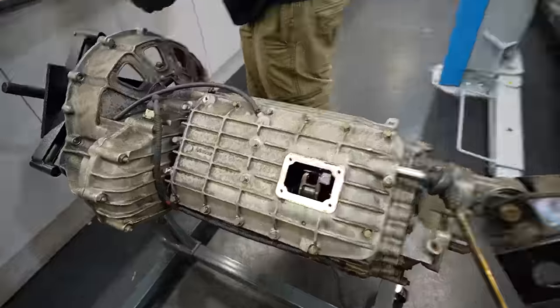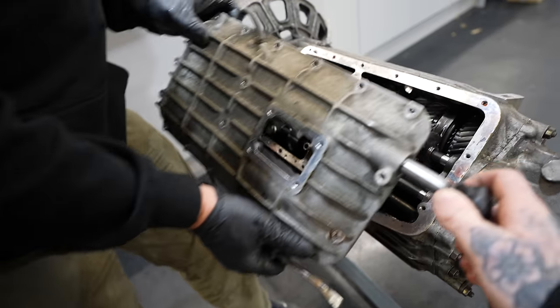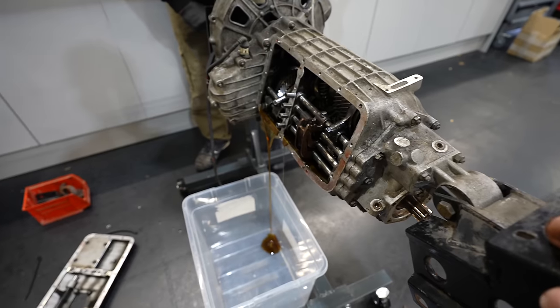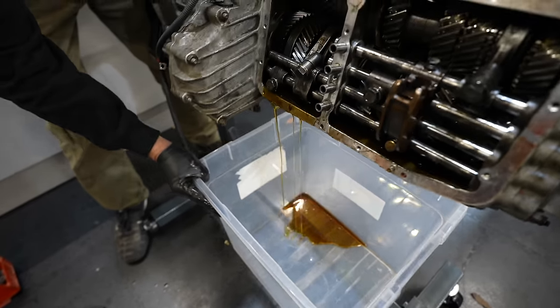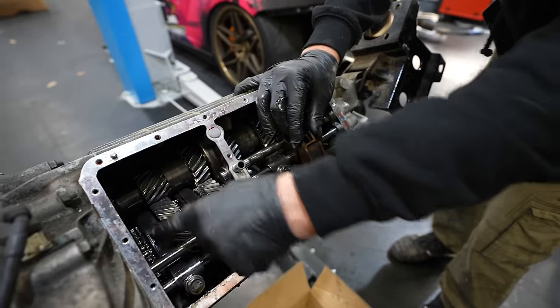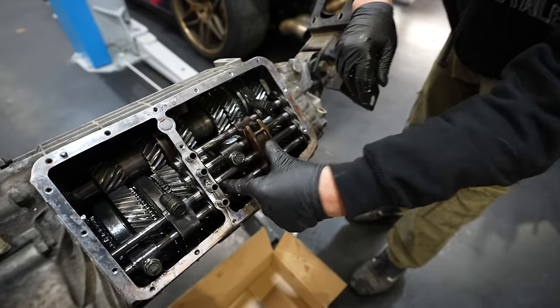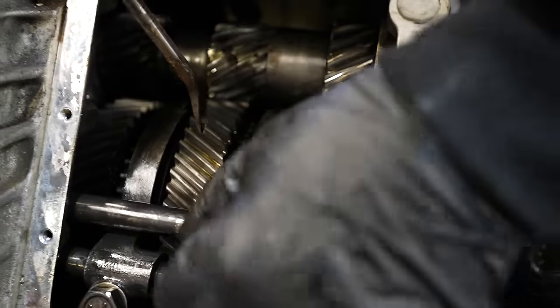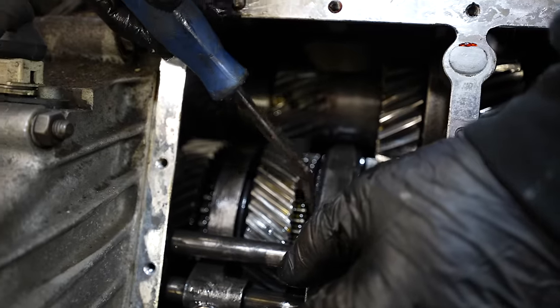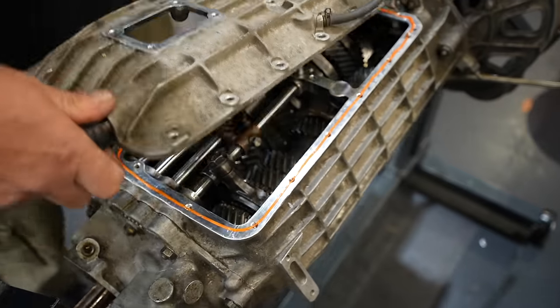Although on a normal car you'd replace the release bearing while the gearbox is out, for 3,000 pounds I'm making sure I get maximum life out of mine. Moving on to stripping the gearbox — and the bad news is it looks like this thing's been apart before. Once we get the gearbox cover off we can see all the gears and synchros. We drain the oil to check for metal shards, but so far so good — the oil looks pretty clean. After a long visual inspection of the gear teeth and synchros, it all seems to be good.